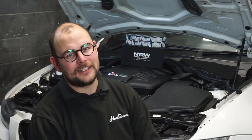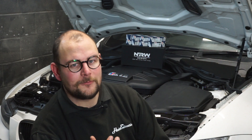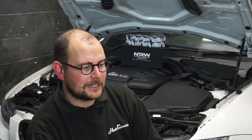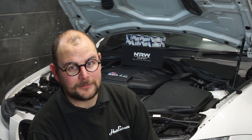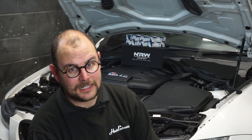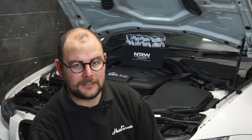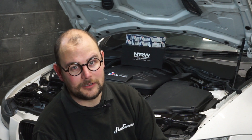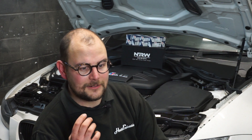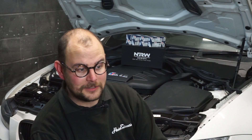The S65 engine unfortunately suffers with injector failures. There are a couple of theories about why this happens, but probably the most valid one is that the fuel filter on these cars is built into the fuel pump assembly — it's a lifetime filter — and over time, whether it disintegrates internally or whatever, debris gets into the fuel injectors, they stick open, and then wash all the oil off your bores, basically destroying your engine with no warning.